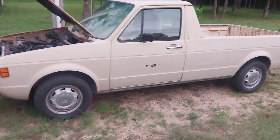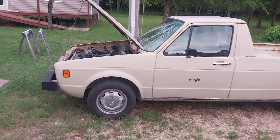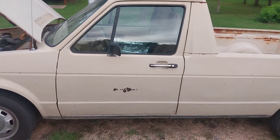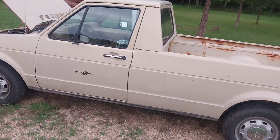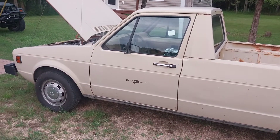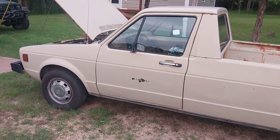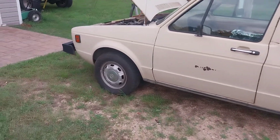So I think I'm going to call this one TSLA VW — Tesla VW — because all the parts from the Jeep are going into this. The Jeep has 16 Tesla modules, and I probably can't fit all 16 in here, nor do I really want to — that's 1,000 pounds worth of battery in a car that weighs less than 2,000 pounds. That motor only needs about 144 to 160 volts. Each of those modules is 25 volts, so if I use six of them, that gives me 150 volts — more than enough for that motor. I can put six of them in here quite easily.